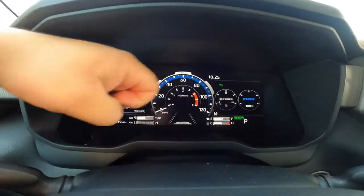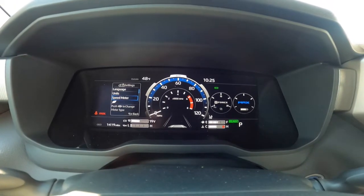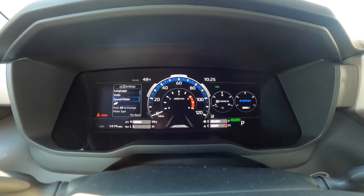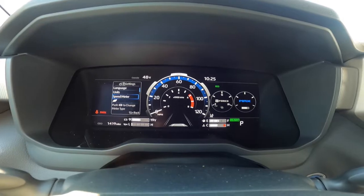Note this too — this is the hybrid. I've got the vehicle running as you can see by the 'Ready' indicator. There are no RPMs and no oil pressure shown. On the hybrid it will shut the engine off while you're driving down the road — you could be coasting on the highway and all of a sudden see no oil pressure, no RPMs. It's fine, don't panic. I say that because I looked at it and panicked myself.